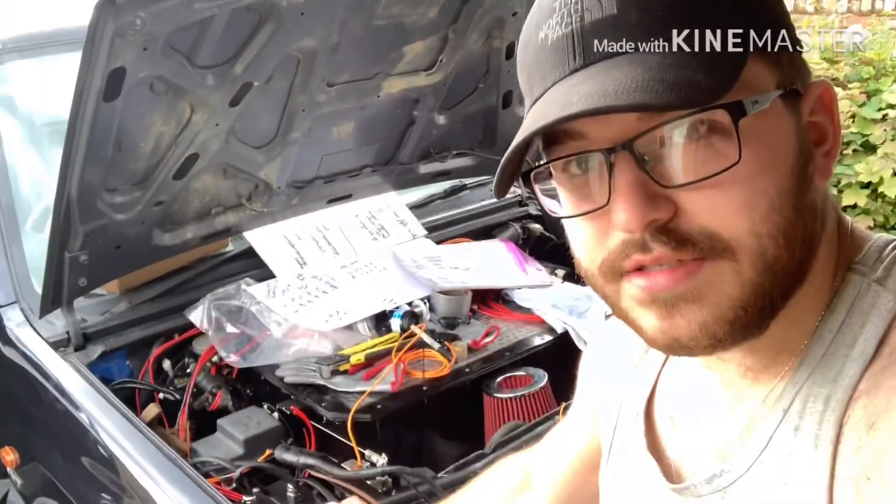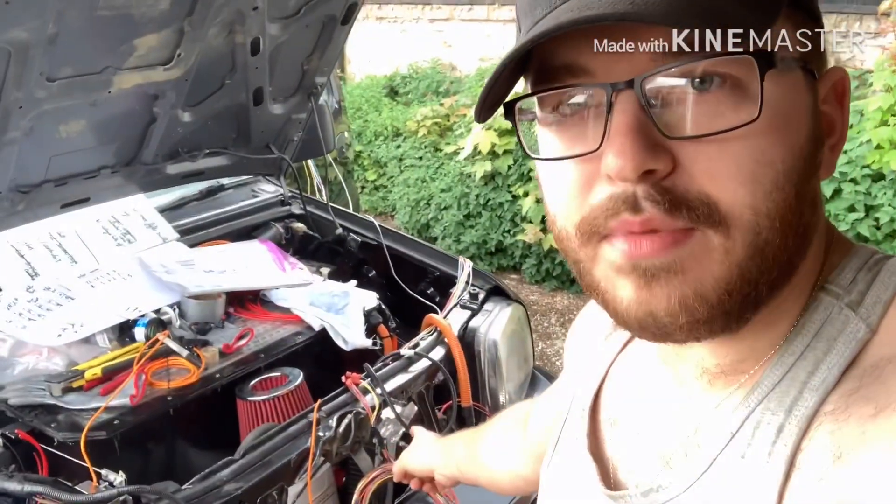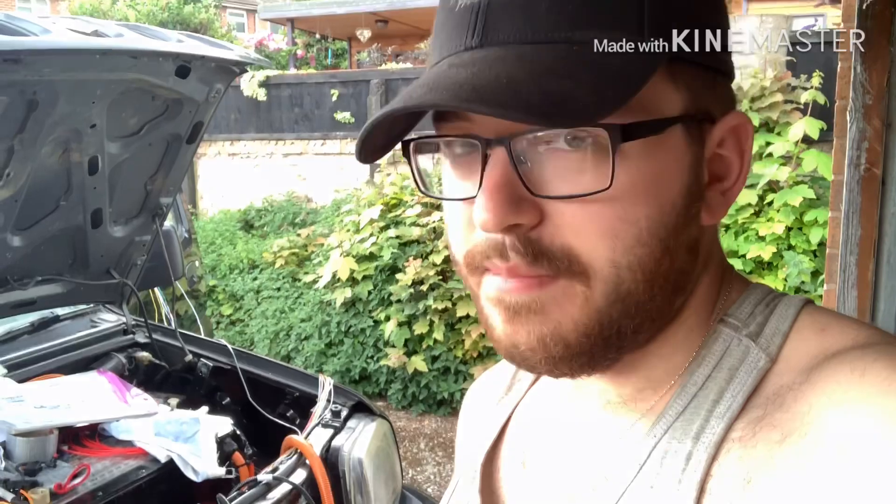For the DC-DC converters, I'm hoping a lot of the time I can just run one to save a bit of juice — not a lot but it makes a difference. For the motor fan, if I want to turn it off and see what happens, see what the temperature goes up to, it's just a bit of troubleshooting and better learning to see how much different things make a difference — such as the chill plate for the motor controller. Having a switch to turn it on and off and manually monitor the temperature will help me notice things like that. We're also going to have a forward and reverse switch inside the car as well.